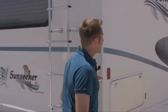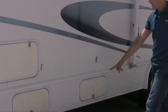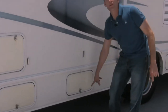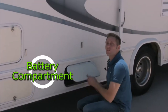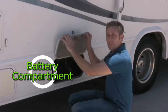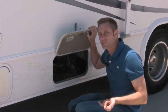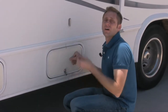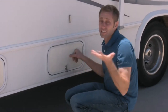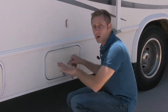Over on the other side, nothing too special. You have storage bays here. One unlabeled bay houses your cabin batteries — not the engine battery. These are for the unit itself. If you can't start your generator or you're showing no voltage on the meter, you may need to jump-start or check these batteries. Again, you should never have to do this, but now you know where they are.